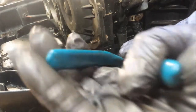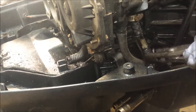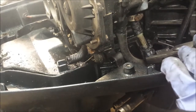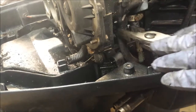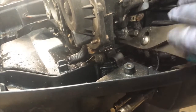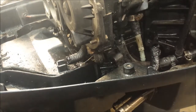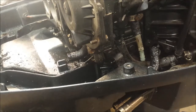All right, that's like the beefiest hose clamp ever. That one fell off on its own. What I do here — I'm going to ditch the hose clamp and just twist it. That'll kind of break its little seal and let me get it off pretty easily. Usually that works out quite well for larger hoses too. Now you're destroying the hoses doing this. However, these hoses are probably original anyway, meaning they're junk and need to go. So I'm perfectly fine with doing this. If this engine was going back together, or should this be a customer's, none of this would be happening.